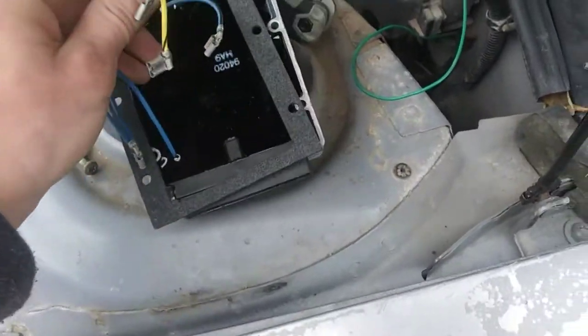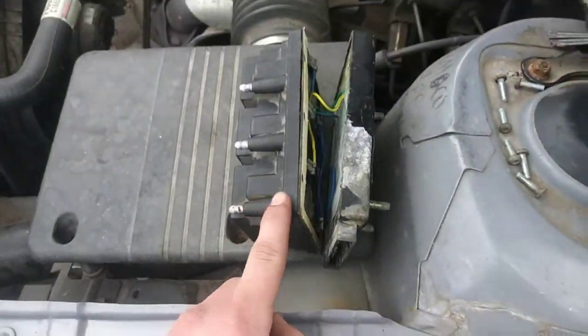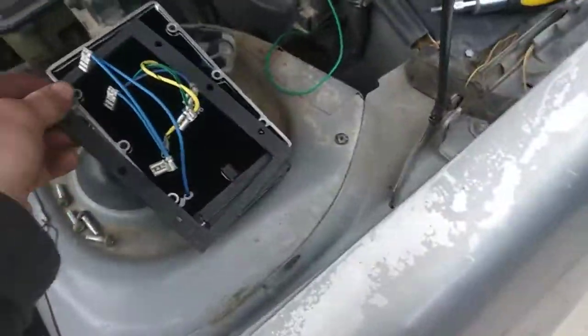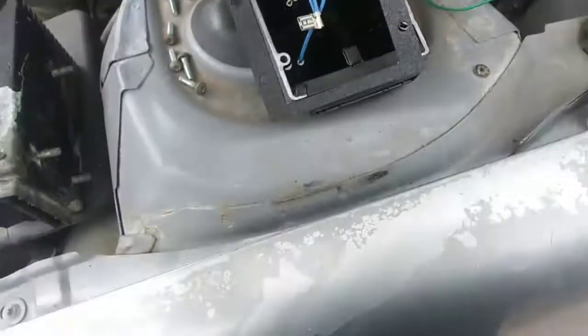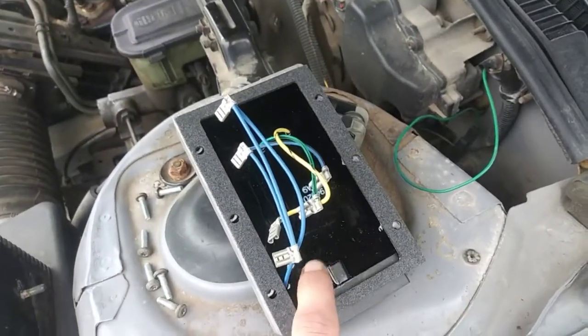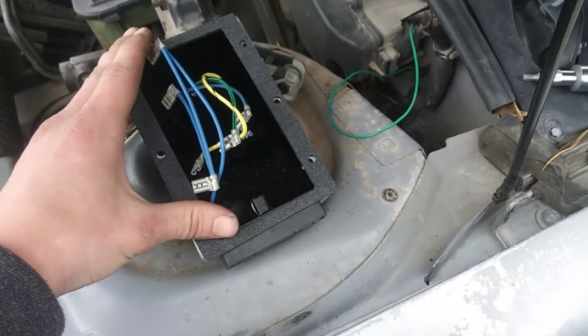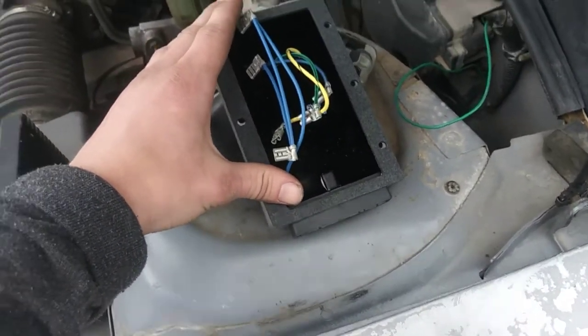On the even side you just have to match them up, then screw your coil packs back on top. It comes with a new gasket — you'll want to make sure you use it because that helps seal out moisture from getting in and will keep some of the heat out as well. So we're going to rewire this up and put it back together.